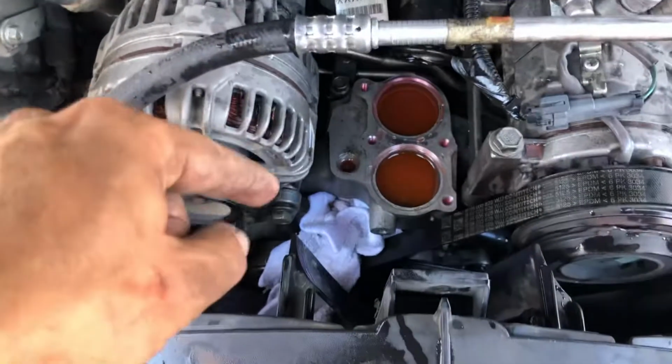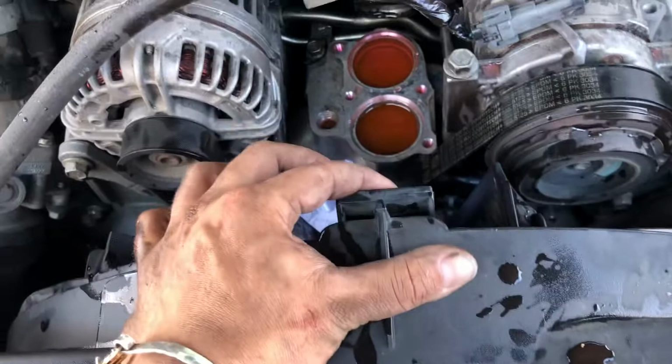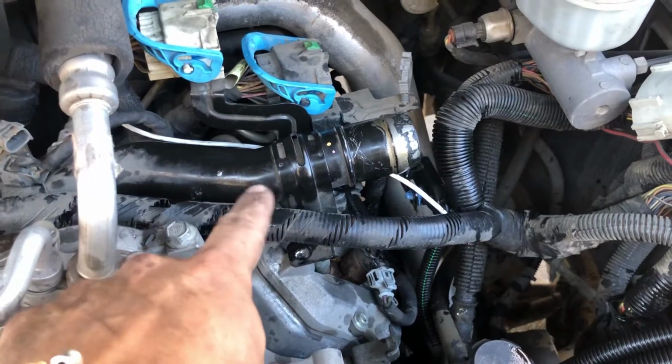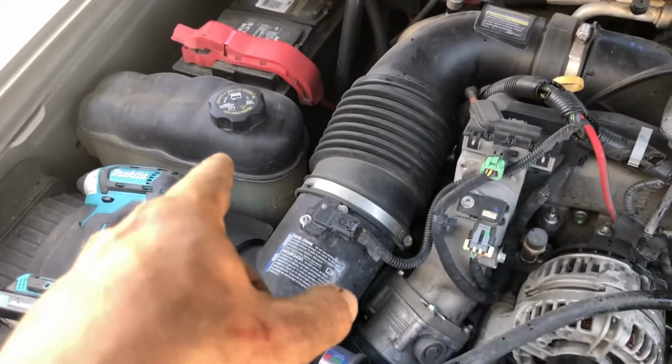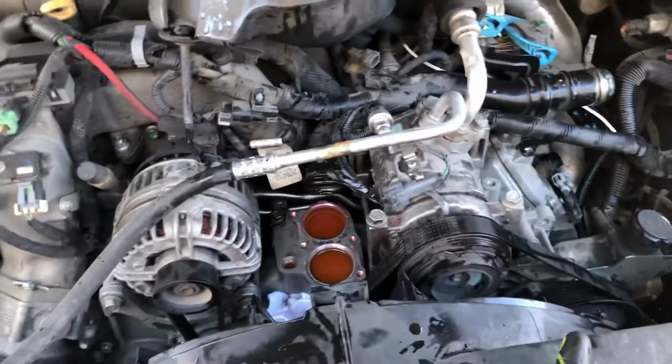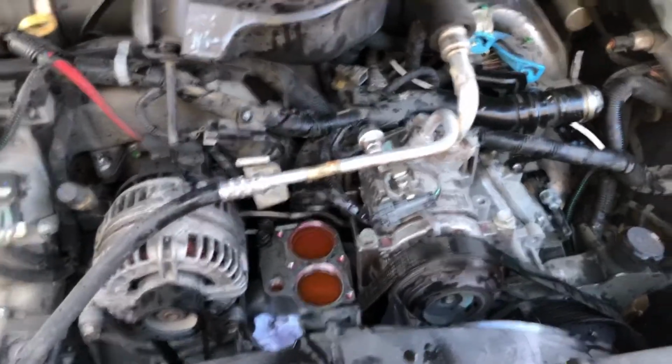I will install it back into that position, and then put the corresponding bracket on top, to then put this in the position here to hold the shroud again, and then continue on while putting the bolts back in for that support, and then the actual upper radiator hose, and then go ahead and top up the coolant and run the truck, make sure and observe for leaks, etc.